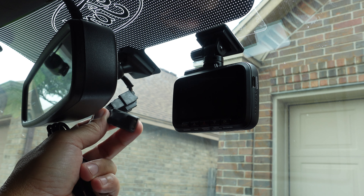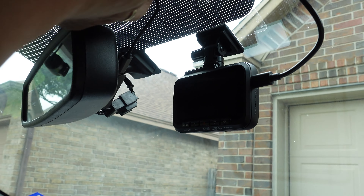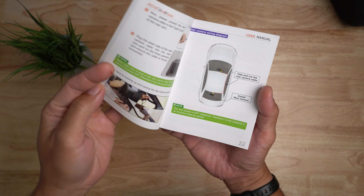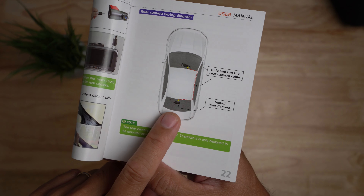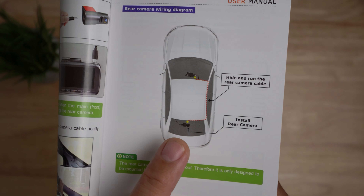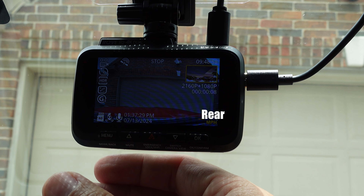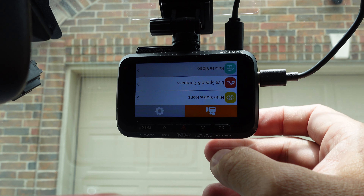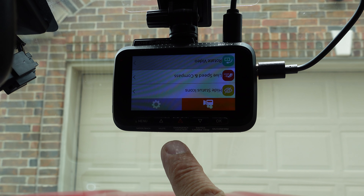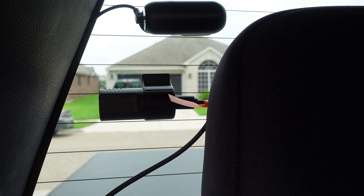I'm using my adapter here to power this, plugging in the short USB-C cable then connecting to the adapter, and doing some cable management. For the rear camera install, the usual way to run the wiring is on the passenger side as shown in the manual, but you can see the USB-C port of the camera is pointing the other way. Most dash cams with rear cameras have a setting to flip the image if installed upside down. There is a video rotate option in the settings but it actually flips the screen, not the camera image. Rove knows about this and will likely have a firmware update — for now I had to flip the rear camera, which puts the wiring in a non-ideal spot.